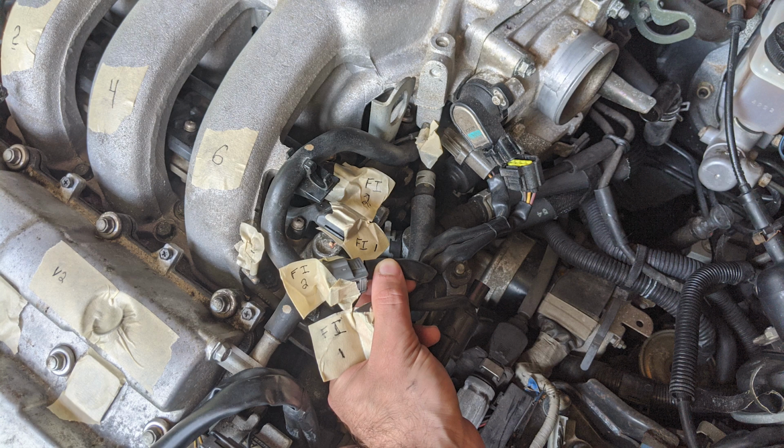You've got 2 copper washers which you're going to need on either side of that bolt. After you pull the banjo bolt, you'll see that 1 washer goes on each side of the fuel line, and the bolt threads through them into the injector rails. Set this bolt and the washers somewhere safe.